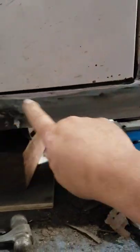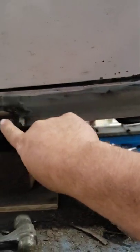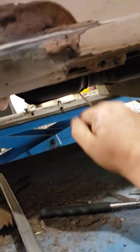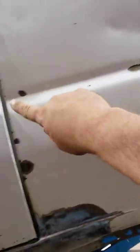So I patched this cab. If you guys recall, those are just dark marks from grinding. But you can see we cut it and patched it. I probably got to do a little bit more sanding right there. I'm not too terribly worried about imperfections like these ones because the chip coating we're going to use is semi-smooth — basically untextured bed liner — so we'll be able to fill in a lot of these imperfections.